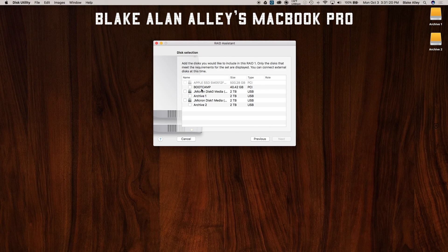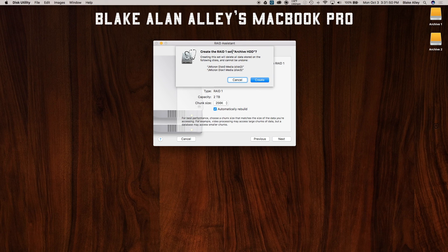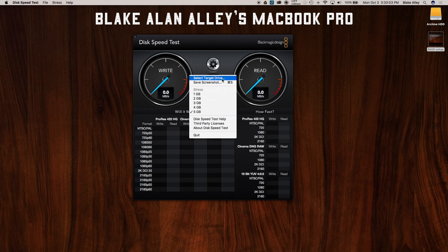I'll go to Mirrored. Next, select these two drives — they're both going to be RAID slices, so they're both going to be active drives. My chunk size I'm going to put to the largest possible size because I'm using it for video and stuff like that. I'm going to call this Archive HDD. Create the RAID 1 set Archive HDD. Disk 2 and disk 3 will be mirrored, so all the data will be written to both disks at the same time. In the event of a hardware failure, it will automatically rebuild this RAID 1 if you add a new drive to it. The RAID is complete — it took about a minute and a half.